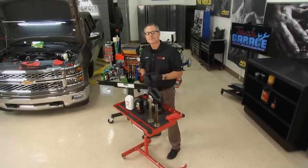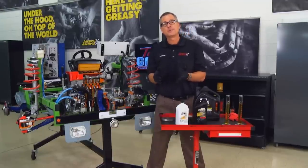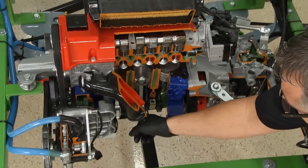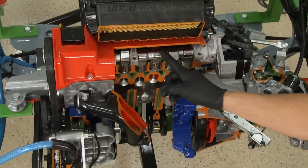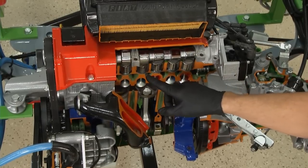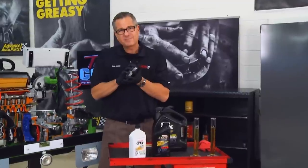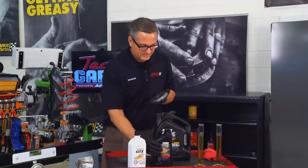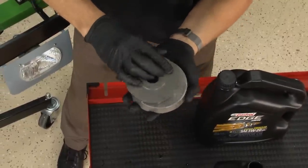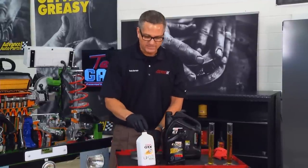It's all about motor oil. Oil serves a few functions: it cools, lubricates, seals, and provides a thin film between moving parts. In the crankshaft and connecting rods, there's a thin film of oil between the main bearings and the block. The oil galleries carry it up to the camshaft and cam bearings, and it also pressurizes the followers and lifters. In a demonstration with two plates, when you rub them together dry you hear scraping; add a little oil, spread it around, and the noise is gone — that's the oil creating a thin film.